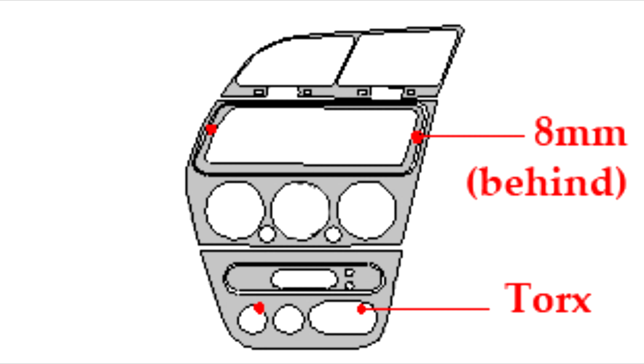I'll show you the proper technique to removing the factory stereo, seeing as mine was aftermarket when I bought the car. Down here we have 2 tabs. And what you're supposed to do is get something like a thin trim removal tool and slide it into the bottom and flip these little clips at the bottom and then slot out the stereo.